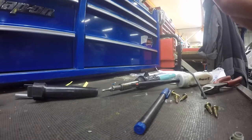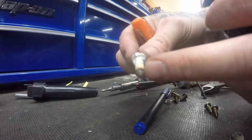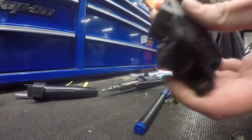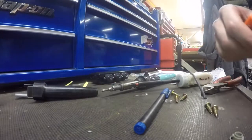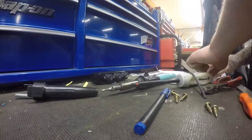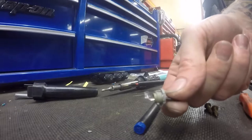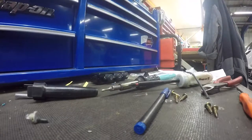I'll pop these out. Once you just pop the LED poking out the end, that's all gravy there. Your resistors just pop out the end there — it's nothing major. So what I do with the ones for the actual heater controls — I poke it out and point them up so it shines directly into the actual diffuser. So it's exactly the same process.